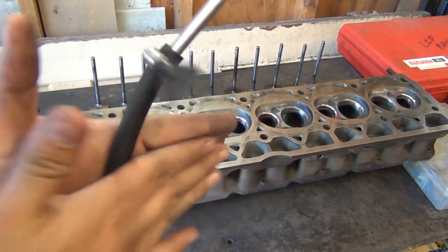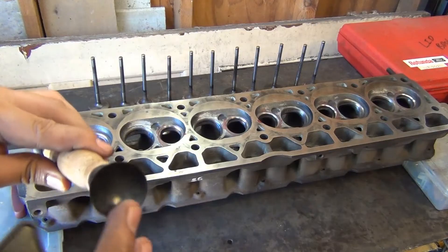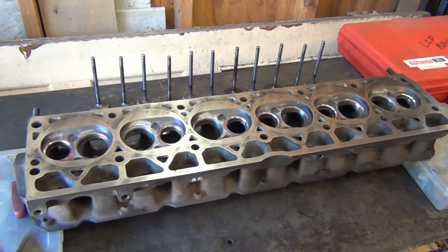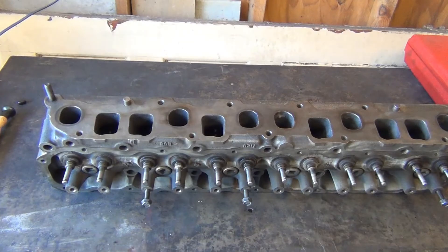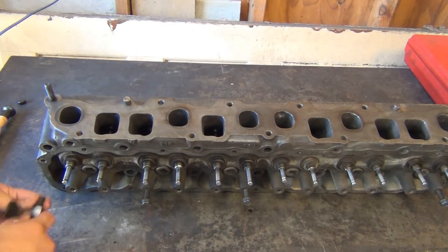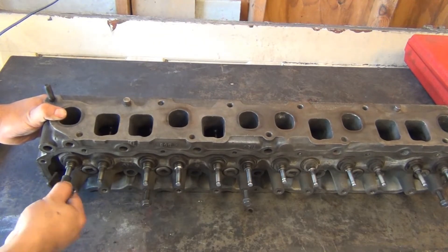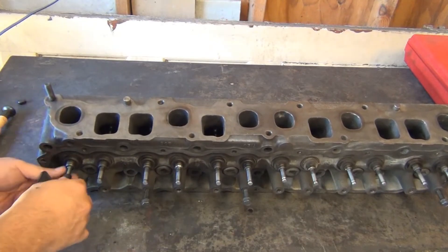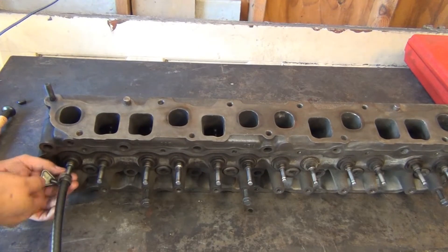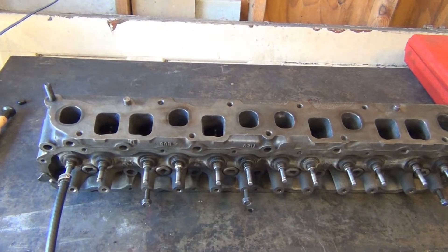You can pull on this hose and do basically the same lapping motion, but you're not worried about the tool unsticking or the stem getting dirty with compound. You tighten a small clamp onto the stem — hopefully one that's easily removed — and that keeps the valve from sliding out as you're pulling on it. Once you have it set up like that, you're just going to do the same spinning motion.